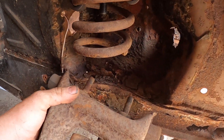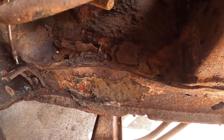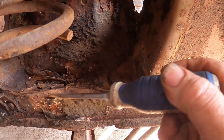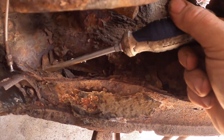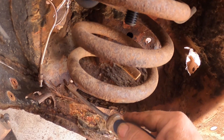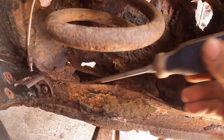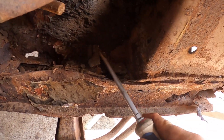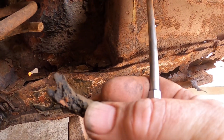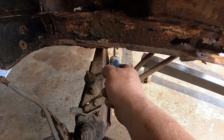All these parts we're not going to be reusing, but look right in here at the frame — it's just gone. That's dented up, this is all gone — look at the rust just falling in there. One of the problems is there are no drain holes, so it fills up with road grime, holds moisture, and just rots out. I don't know if that's undercoating or road grime — I think it's road grime.